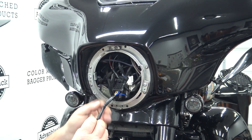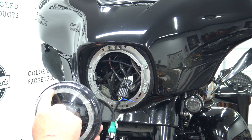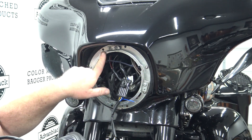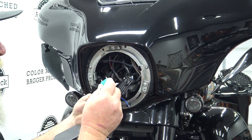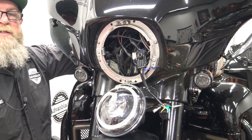We're going to bring the new headlight up — look for the lettering on the headlight and make sure you can read it; it goes up just like that. On the back side of the headlight you can see three squares — these three squares actually line up with the three squares in the adjustment bezel, so it'll only go in one way. Go ahead and plug this in. With it set just like that, let's go ahead and test the light.